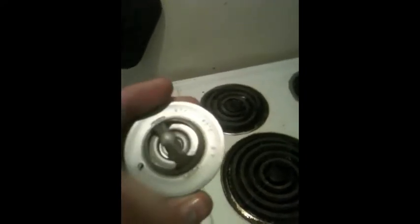So here's what you need. Here's your thermostat — pulled it out of my '87 Samurai. It's an 82 degree Celsius, which is like 180 Fahrenheit.